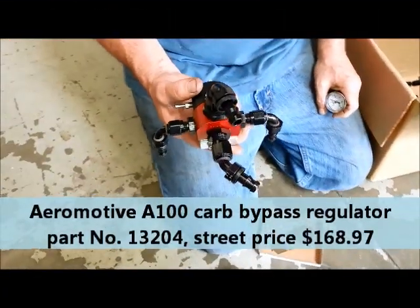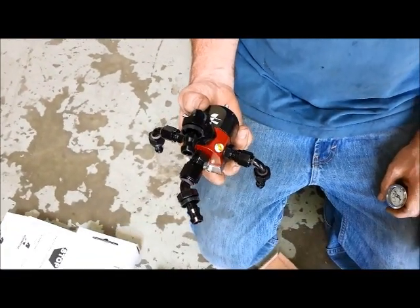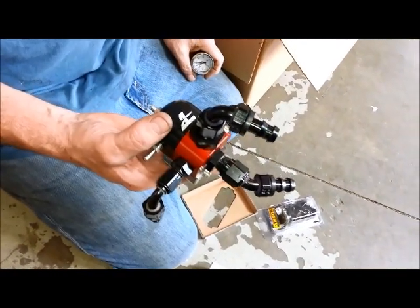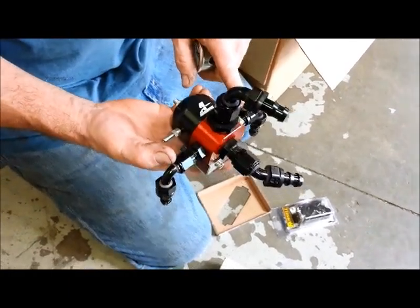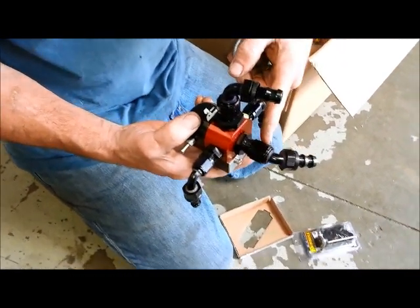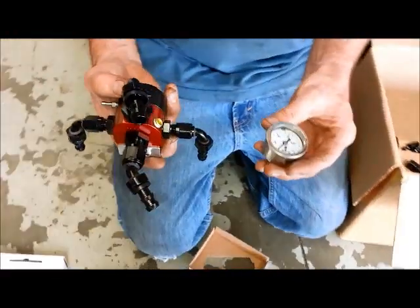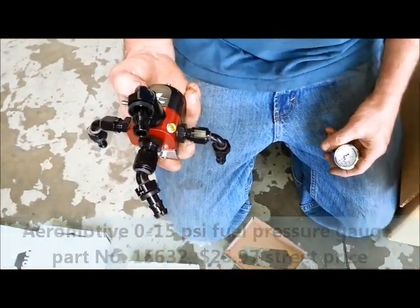This is our Aeromotive fuel pressure regulator, and Aeromotive's been making fuel pressure regulators for a really long time — some of the stuff they made 15 years ago is still on race cars doing great work. In this case we've actually got one feed line coming in, and then we're going to have a split outlet between two carburetors. We've got two Edelbrock 500 CFMs, and then they're coming back and it's going to return to the tank. We're getting all our Russell Twistlock AN fittings set, and there's a gauge — we want to make sure that we have a port there where we can set the fuel pressure when we're getting the engine all set up.